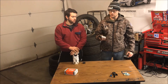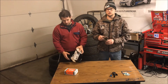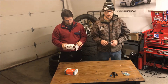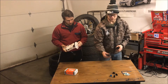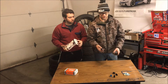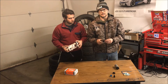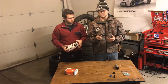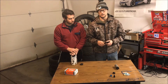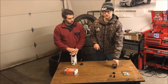When you're using a pump like this, you need to check if you have a check valve in your system. The Walbro has a check valve, so once you shut the car off the fuel doesn't pour back in. When using something like the DW 400, you want to add a one-way check valve. This is a check valve from Summit Racing — 6AN. We're going to connect it to my fuel filter, which is a K&N 10 micron, and put it underneath the car. When you go to this pump, always remember it doesn't have a check valve, so add one — it helps with cold starts.